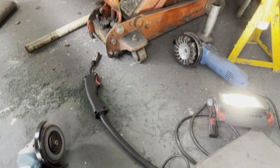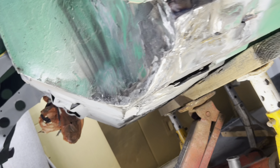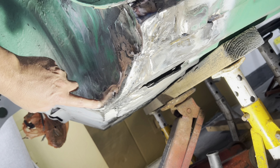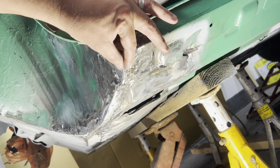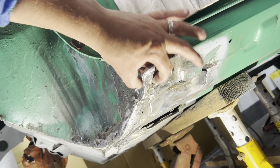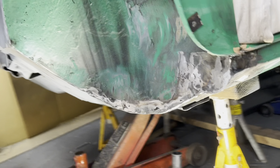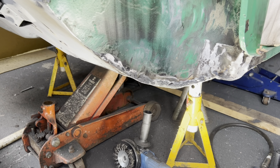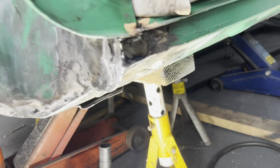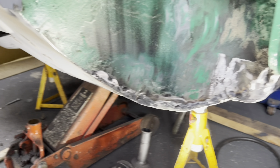So quite a few hours of welding, filling with metal, and linishing back. We've got all this nice and stout now. We had all these holes just underneath here — this is all now filled. We've reinforced this area and backfilled it, so this is nice and strong. We've put a layer in here and here to reinforce it, as well as filling some holes. It's not concours — I didn't want it to be — but the main thing is it's not got rust and it's proper strong now. We've got a lot of cleaning off to do. It got a little bit hot and we took some paint off there, which I'm a bit peeved about. Work in progress though — this is the bits I knew were there and just wanted to turn a blind eye to, but we're facing the fears and getting it sorted.